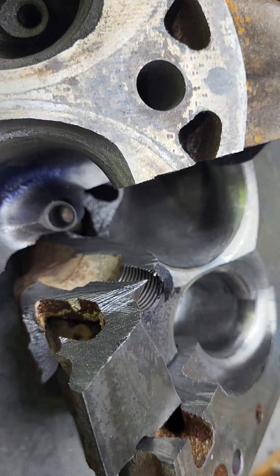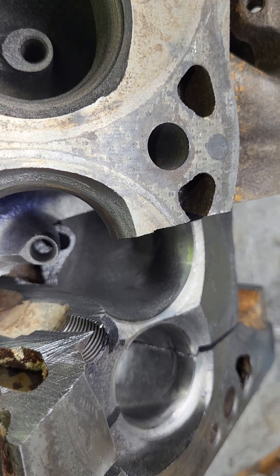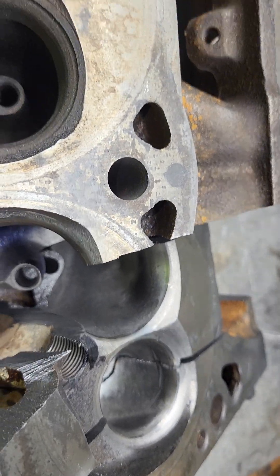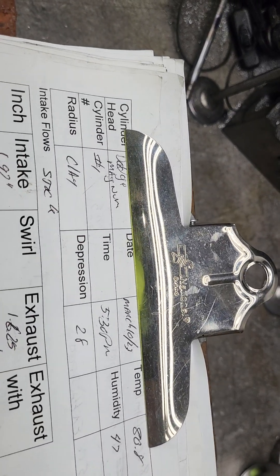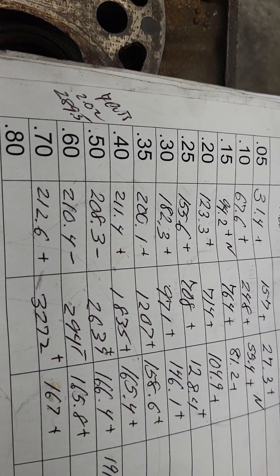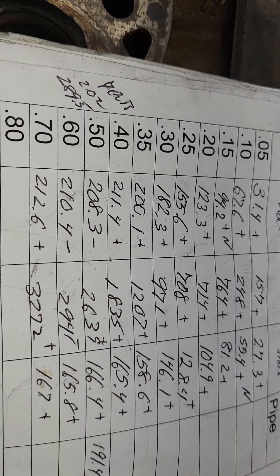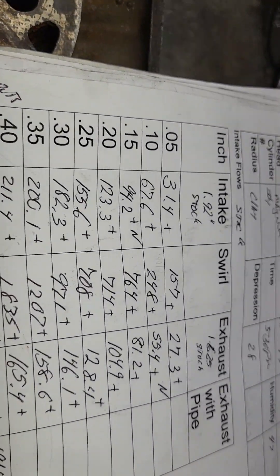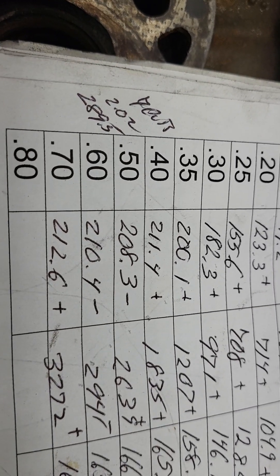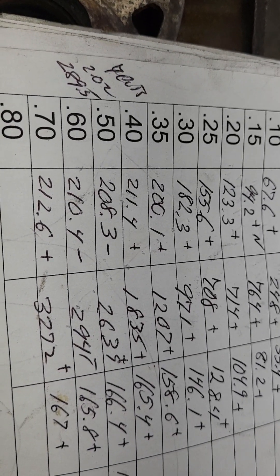I got a lot out of these mundane heads. I only found the flow sheet from the stocker and had to go to the video to dig up what it peaked out at after seven cuts. Stock was 208-210 CFM. With a 1.92 valve stock, after seven cuts I went up to a 2.02 and got 289.5 CFM out of that, which is pretty damn good — you can make a good amount of power with that.